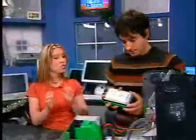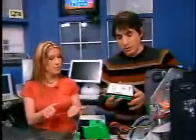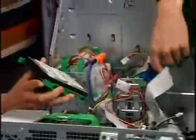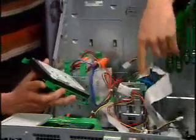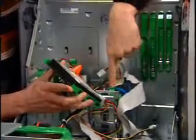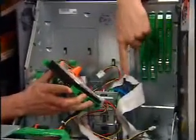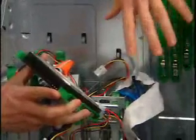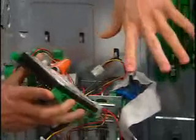But for today, we're just adding a drive — just adding storage. So we've got a drive here and we follow the chain. This is our existing hard drive. It's important to know two things: you can store two devices on a chain. You'll see one's plugged in here, and then we have an empty connector right here that's ready for a new drive.